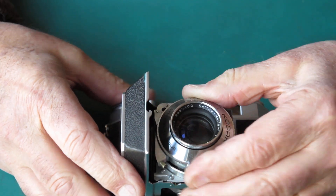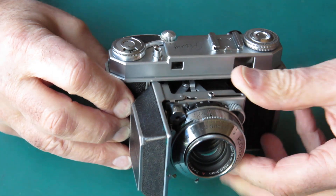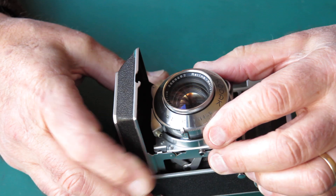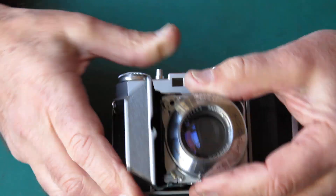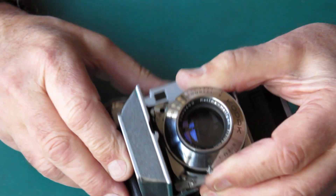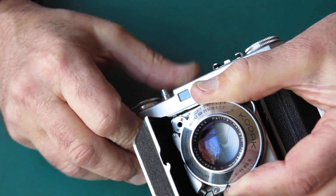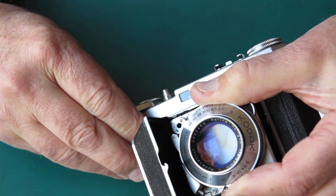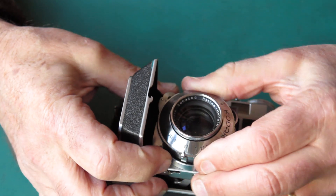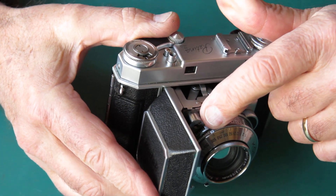What's causing this? It'll be the position of the shutter — the timing's not right. It's a loose shutter and the timing being one tooth out from the ideal position. You'd certainly find that if you set it to 1/500th of a second, you end up with nothing. You can see the shutter blades open and close — that's what he was getting, except on all the speeds. It's simply because the shutter is loose and the timing is not correct.